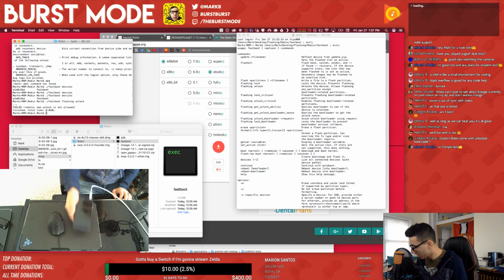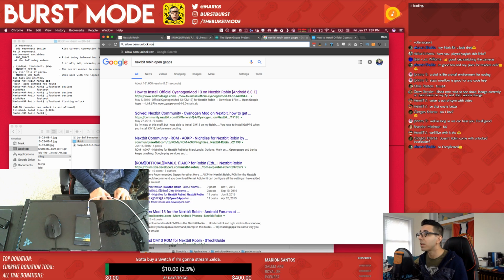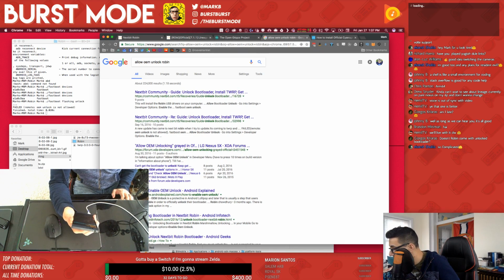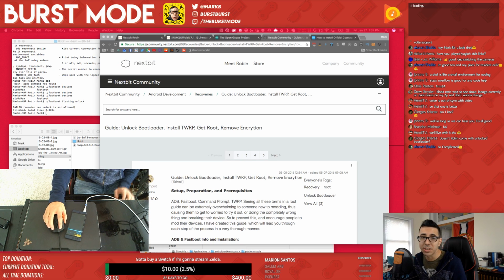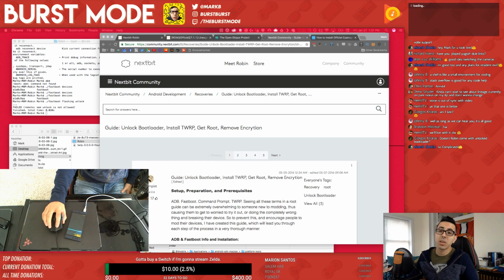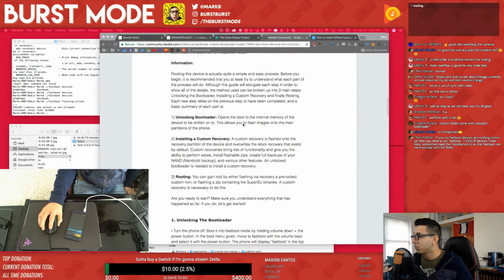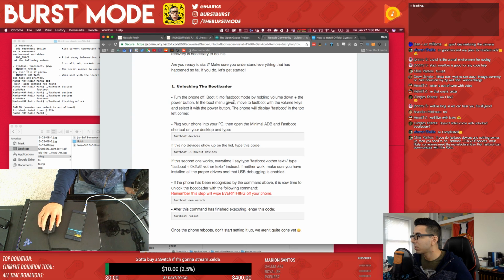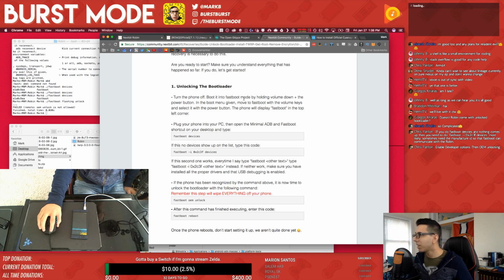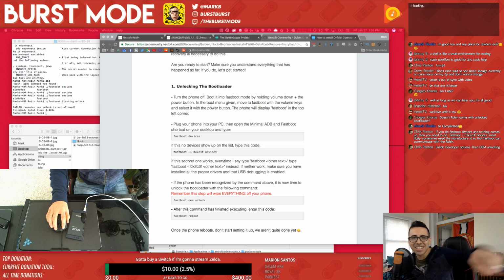So let's go to recovery. I think there's going to be a setting there that we need to turn on. Allow OEM unlock Robin. And while that's booting, I'm just going to do a quick Google search just to make sure. Reboot, apply update, wipe data, factory reset, wipe the cache partition. Let's see. I also want to make a quick mention. Yeah, it's kind of complicated. No, it doesn't come with an unlock bootloader, but it does come with, like, the warranty doesn't get voided if you unlock the bootloader. Wow. Fastboot devices. How do I enable OEM unlock? I think I got to do it in the system. So let's go ahead and just boot to the system. Yeah, it's in the system. See, look at this. Chris, thank you so much, Chris.